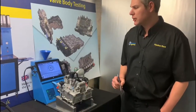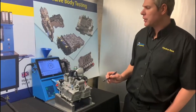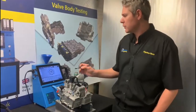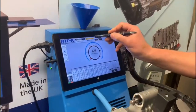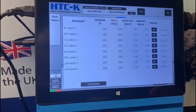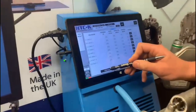Now we'll take a closer look at the all-in-one DSG unit. This particular unit — everything required to complete the valve body test for the OAM is all within this particular test equipment. I'm going to take you into a quick solenoid scan. Testing the solenoids, we're now monitoring current — the amperage of each solenoid. Once we're happy with those results we'll continue.